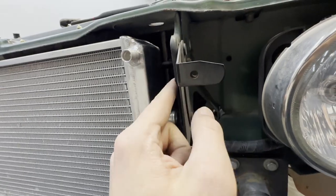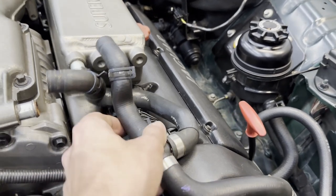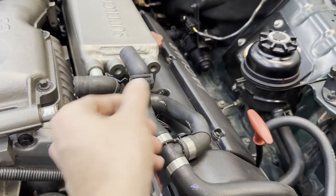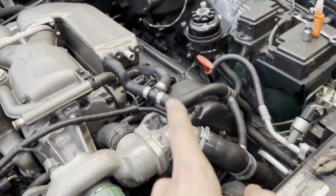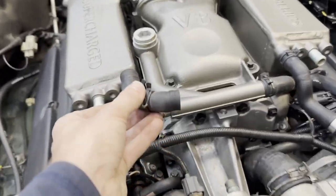Connections done and looking good. Moving on to the last two connections from this octopus hose — there's this little kink arrangement where it kicks around under itself and then over itself. These make up the connection here and the inner connection on the driver's side charge air cooler. One plugs on there and one plugs on here. With those connected, that completes the octopus hose. We still need to connect the one up front on both sides — those are routed and ready to go. Next up on top is this little elbow which goes right here.